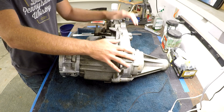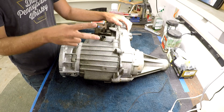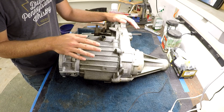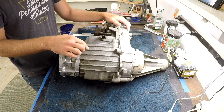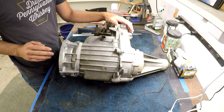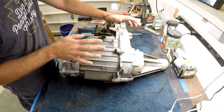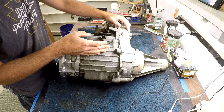If you watch the previous video about my recipe for swapping the LS into the Suburban, you'll know that I got a two-wheel drive 6L90E. One of the biggest challenges with the 6L90E two-wheel drive is the output shaft — it's a 36-spline massive output shaft. As far as I can tell, there is no reasonable transfer case that you and I are going to pull from a junkyard that can accept that 36-spline input. What you have to do is take the transmission apart and get the output shaft re-splined down.